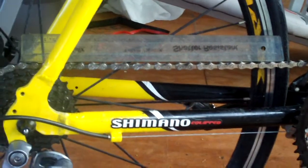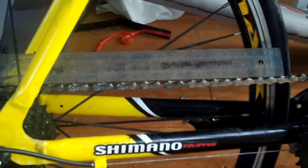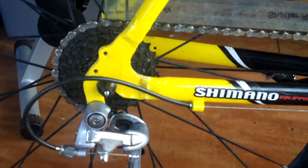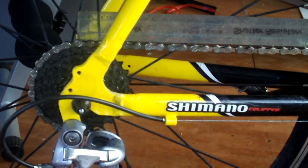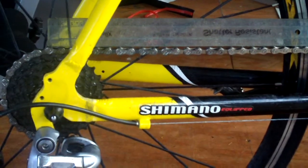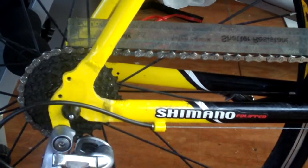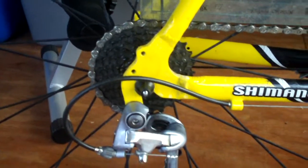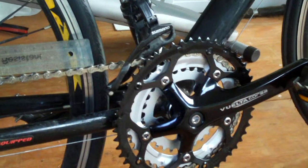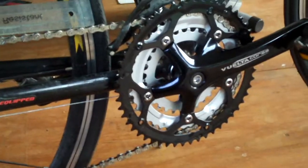In this video I'm going to be talking about bike chains and how you can spot if one is worn out. On any kind of bicycle, whether it be a fixed gear or one like this that's multi-speed, it's important that you check your chain once in a while if you ride frequently, because over time your bicycle chain wears out and stretches. If you leave it like that for too long, it can eat up your gears — your freewheel or cassette, or your crank set gears. That's not something you want because it can cost more to replace those components than just the chain by itself.